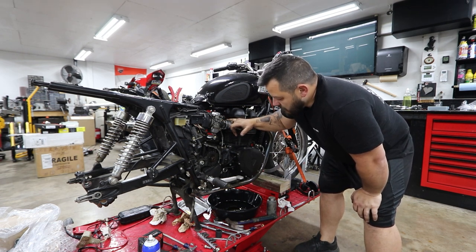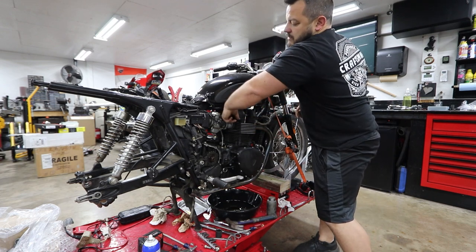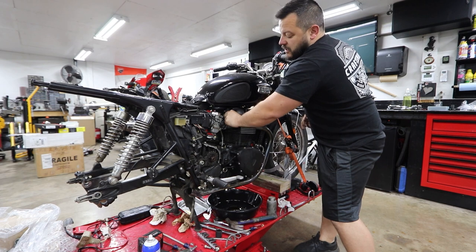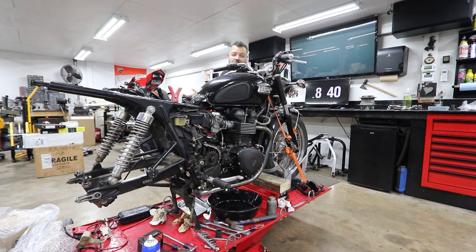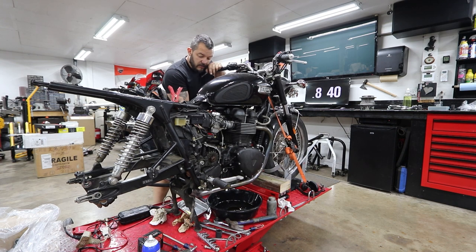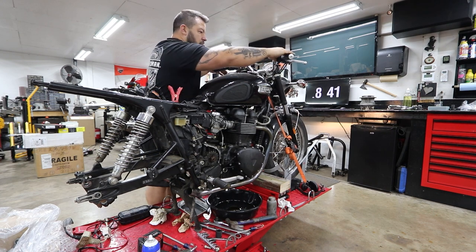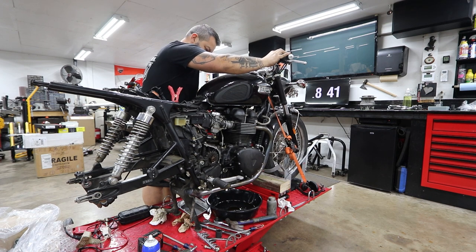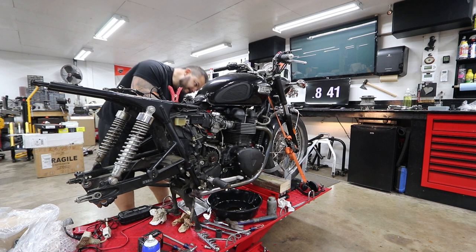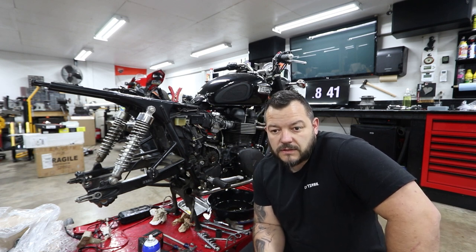I put the caps back on to see if I can fire the bike up. I'm really disappointed it didn't just start, but that's how it goes with stuff that's been sitting or messed with if you don't know what you're doing. The battery was dying fast because I kept cranking it over and over, so I gave it a few more minutes on the charger. Hmm — that's bad. It appears that we have no spark, so I'm gonna have to test a few components next time and I guess we'll continue in the next video.